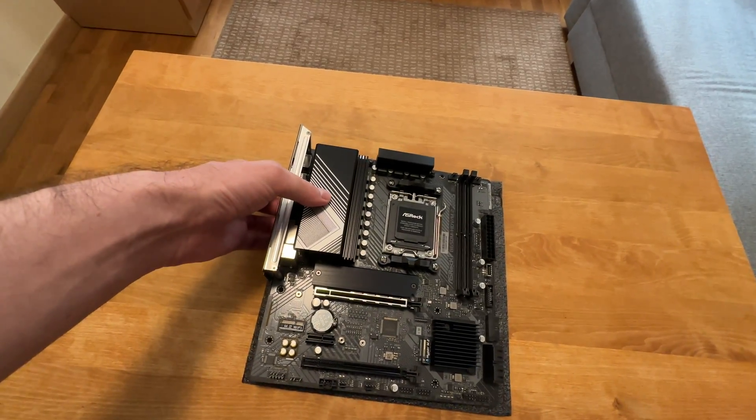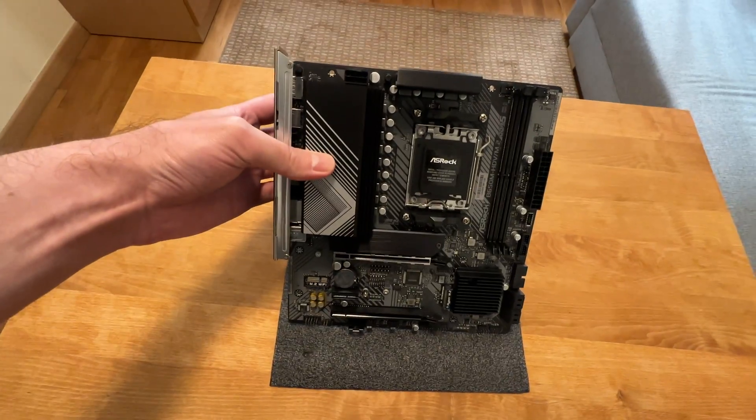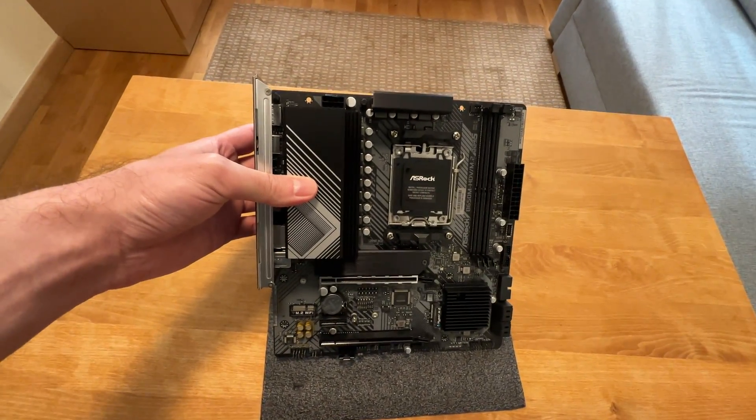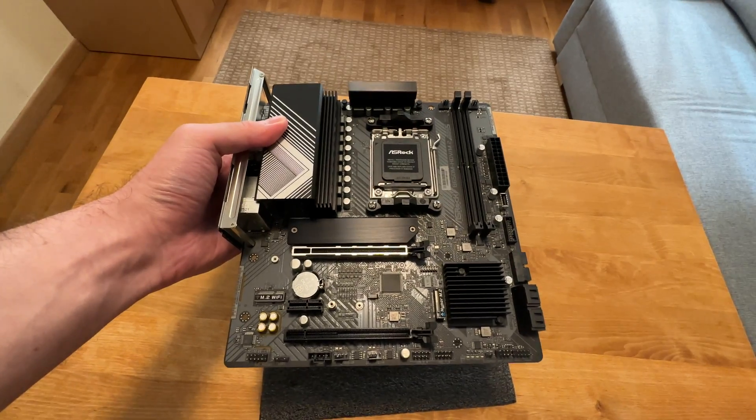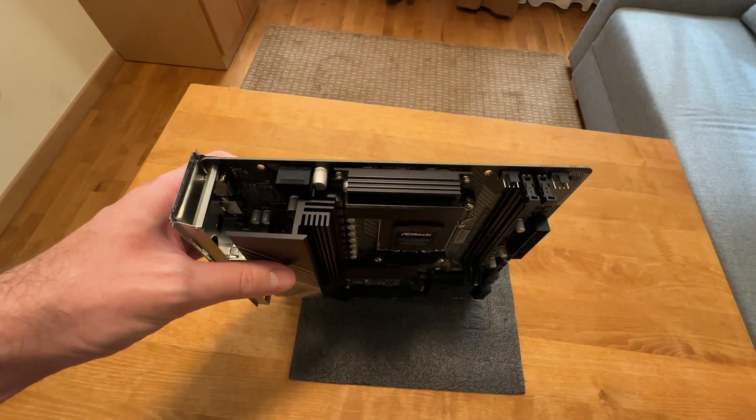It's been tested — you can install the 16-core 7950X in here and at full load test it for one hour. This motherboard doesn't go over 80 degrees on the VRMs, so that's very good. That's the most powerful CPU, and this motherboard can handle it no problem at full power. So you can install any CPU you like and enjoy this motherboard.